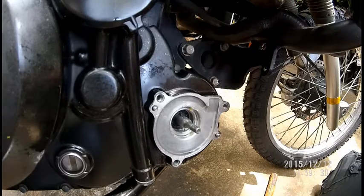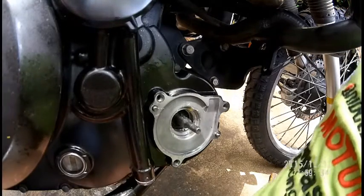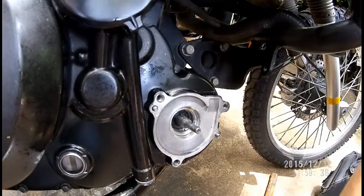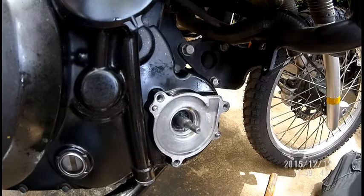That explains that. This is perfect. It's the only time I use this one. This also fits your dog bone linkages. 22s are there. In case you need to drop your linkages when you're stuck out on the road, you can do that. So buy yourself a 22 socket. You can't use it much anywhere else, but it must be a 12-sided one.